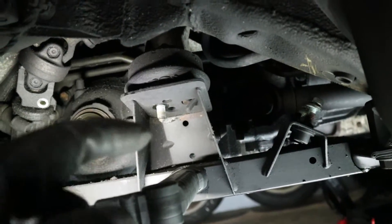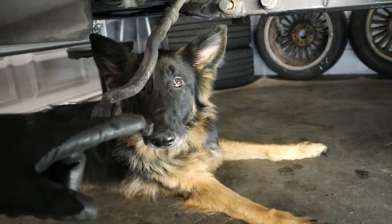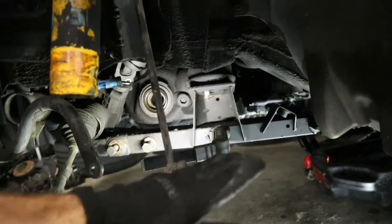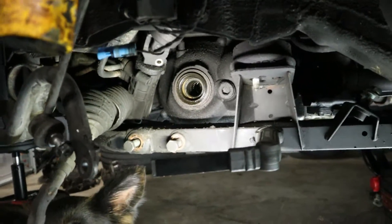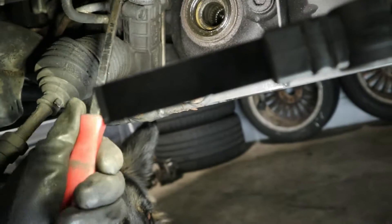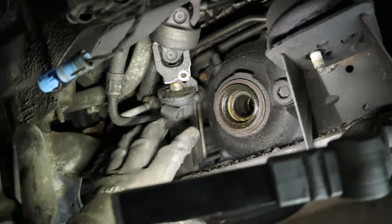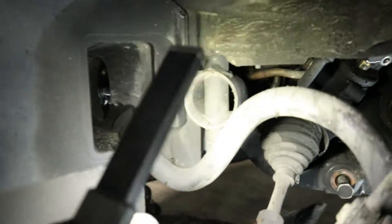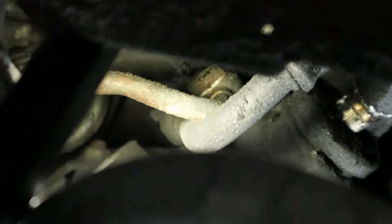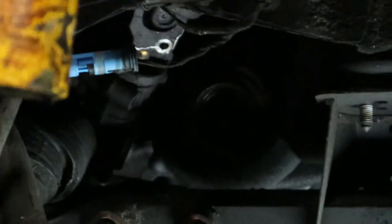We had to remove the nuts holding the motor mounts to the subframe. I also got this bolt here for the steering shaft, which we're going to remove — and there we go, it lifts straight up. That's part of the steering column; it'll stay up in the air while the steering rack comes down. We also had to remove the sway bar end links on both sides since the sway bar is attached to the subframe. The steering rack is still connected by some power steering lines right at the front, so we need to pull those off before dropping the subframe.